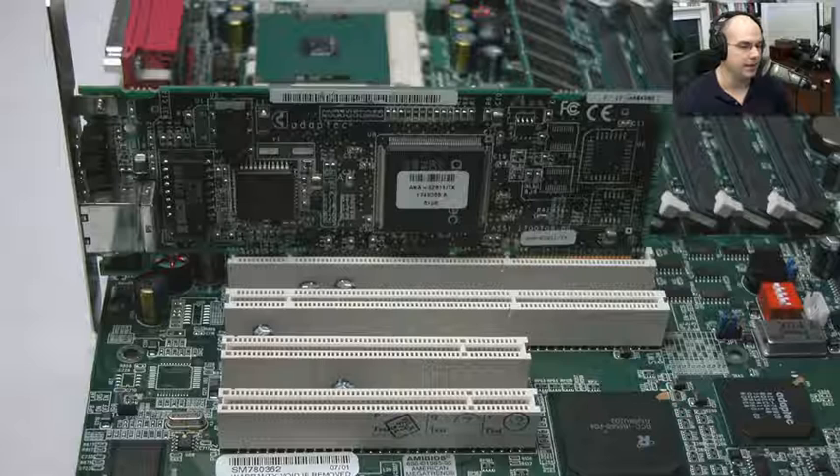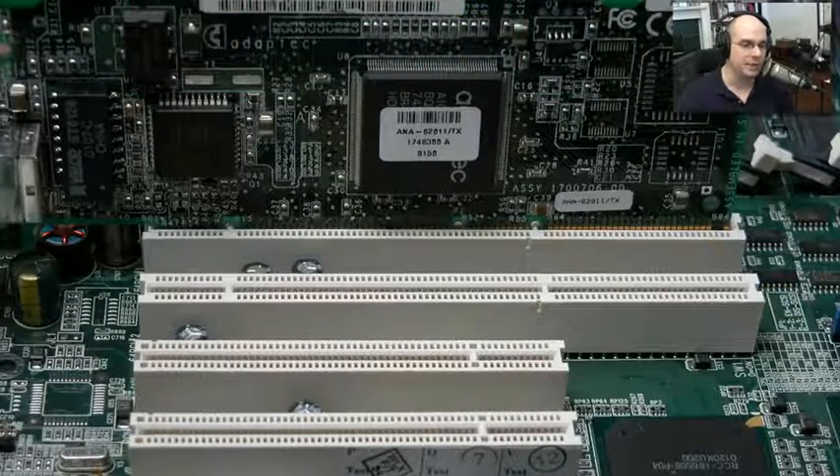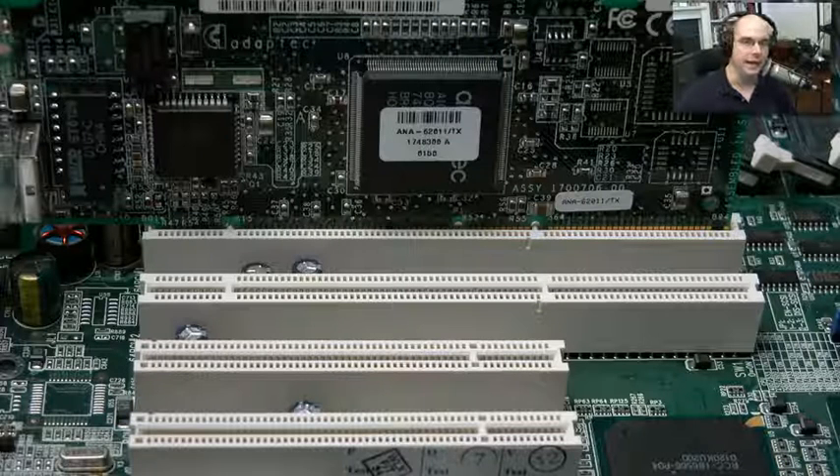It should simply fit all the way in. One thing you'll want to check when you put it into the slot is there will be a notch at the top of the adapter card where it screws into the case itself — make sure that you screw it in. What you don't want is this card sitting outside of the slot a little bit. Notice that it fits all the way in on one side, but it's sticking up a little bit on the edge — it's very common to see if it's not installed properly, and it could result in a bad connection. Make sure you don't see any of the copper contacts sticking out, and make sure it's in there completely before you close up the case and turn the power on.